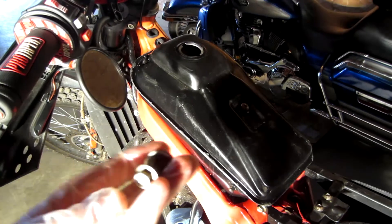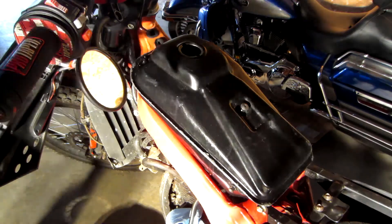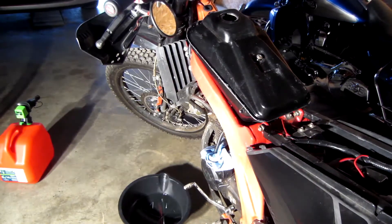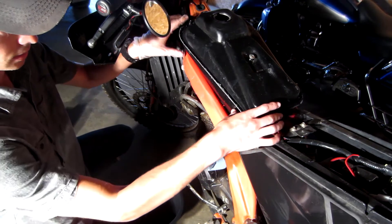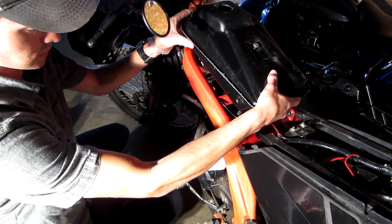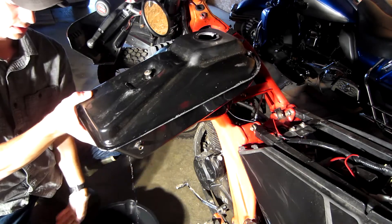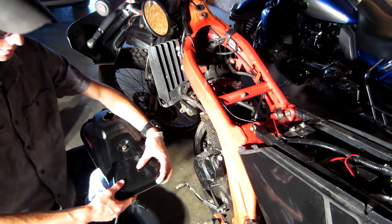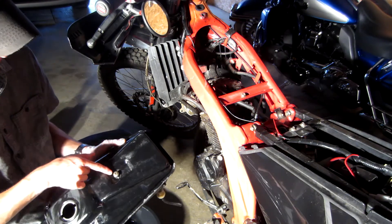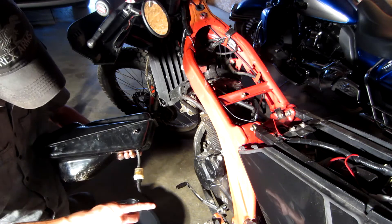So that's the bolt. There's still some residual gas left in this tank. I'm going to try to get it off and over the catch can as well as I can. The tank is pretty much empty. We need to get some things off here — we need this, which is the mounting screw for the seat, and then we need the fuel line and the filter.